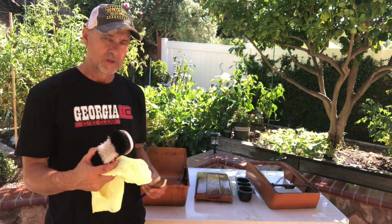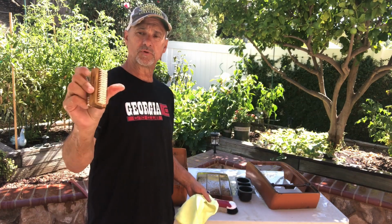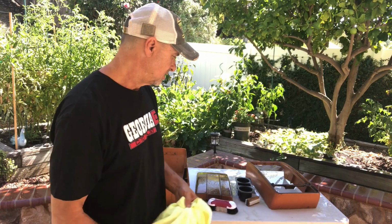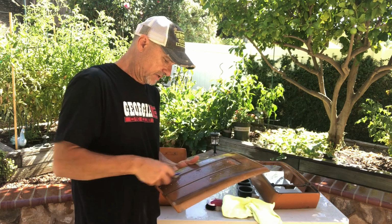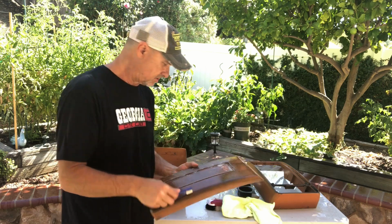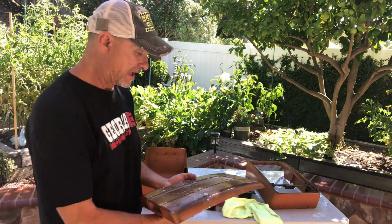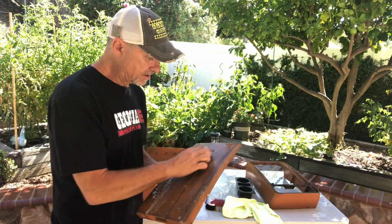Next, I just take a tire scrub brush, a little nylon. They're both nylon brushes, one with a thinner strip of bristles and then a little thicker one, a toothbrush for the console lid, and just a rag. So I take the toothbrush to get down into the grooves on this console lid. You also have a lot of texture on this lid that we want to pop, so the best way to do that is to get the dirt and grime out of the little texture on top. That way it can all shine and come through when you get it painted.